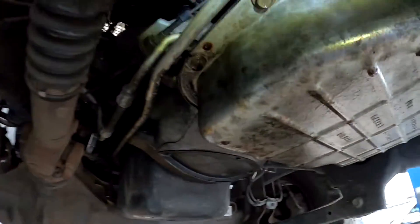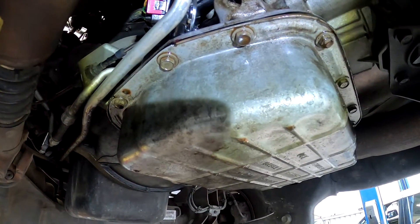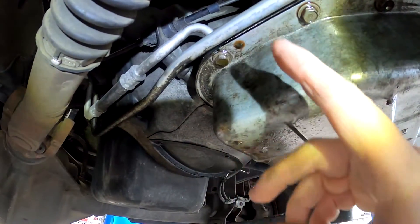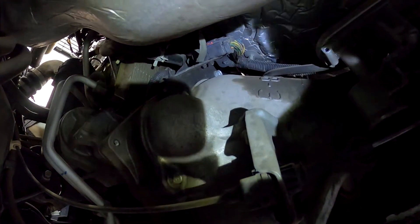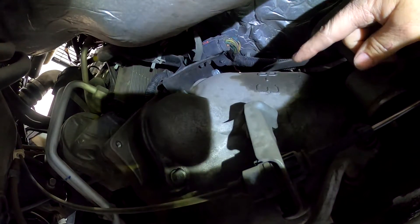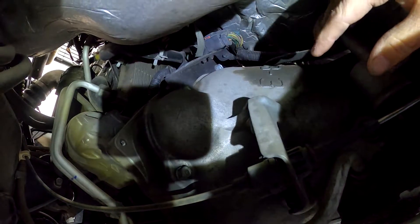Now we go to the driver's side, or the left side of the transmission, and it is really wet. One of the things you want to do when looking for a leak is go as far forward and as high as you possibly can. If we go a little bit higher up, it's pretty dry — there's a little bit of dried-up dirt and fluid, which is probably fluid that spit out of the vent, likely from a trans service where it was a little bit overfilled, but that's not actively leaking.